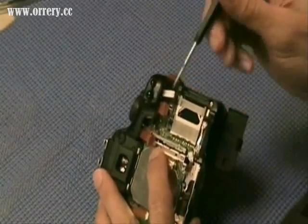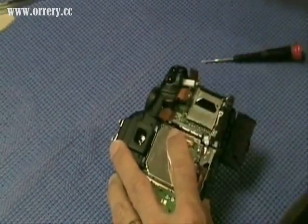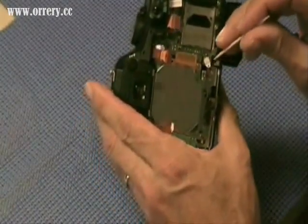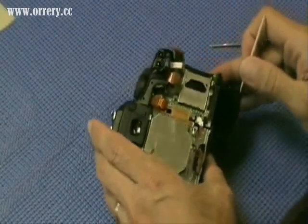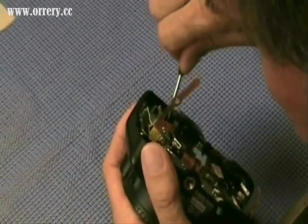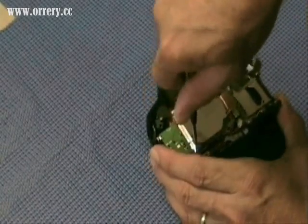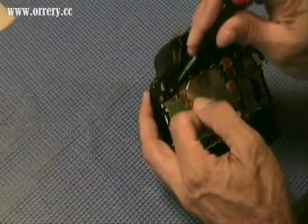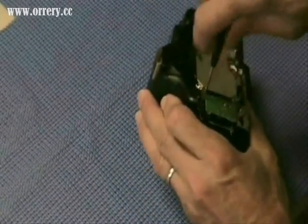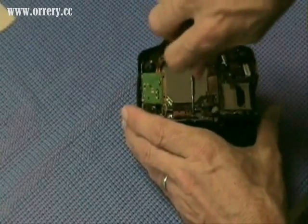Next, we are going to remove one long screw located here and tape it to our screw sheet. There is also a very small white ribbon cable connector that is a slide-out — we use our pick, insert it in the hole, and wiggle side to side gently until that ribbon cable becomes undone. There are four screws left to remove. The first one in the upper left-hand corner is at an angle. The next long screw is very easy to get at. We tape all these screws to our screw sheet. There are two small screws remaining — we undo and place them aside. The final screw sometimes has a little bit of black adhesive around it that you need to cut loose with a razor knife.